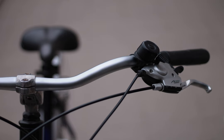If you have a 5800 SS short cage derailleur, the max large sprocket is 28. If you have a GS medium cage, the max large sprocket is 32. See the Shimano specifications PDF at: product info dot shimano dot com, 2017-2018 specifications, search for road 5800.